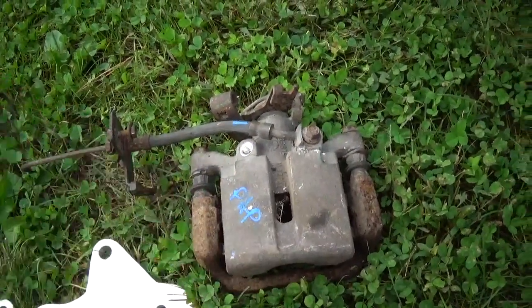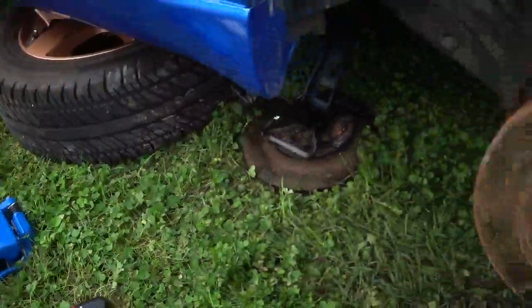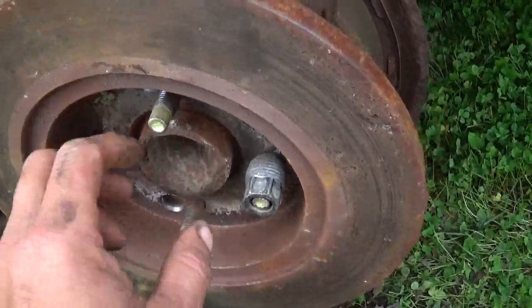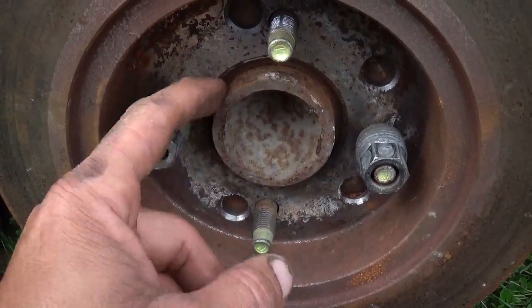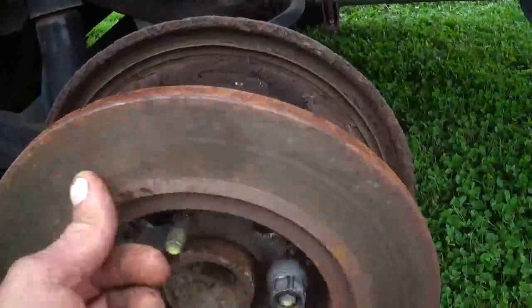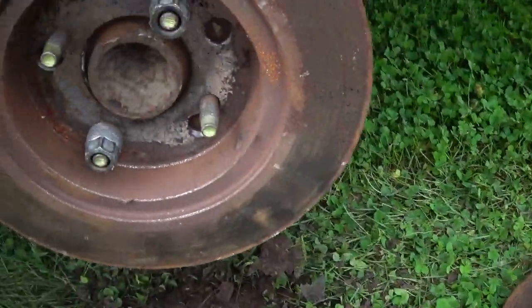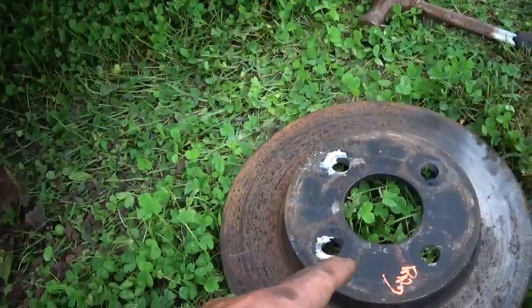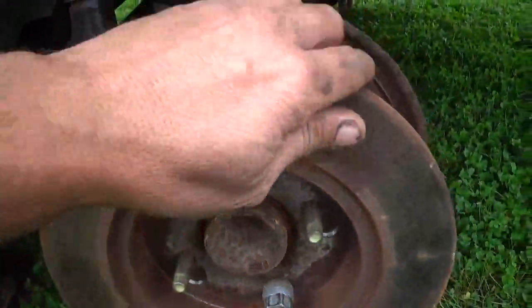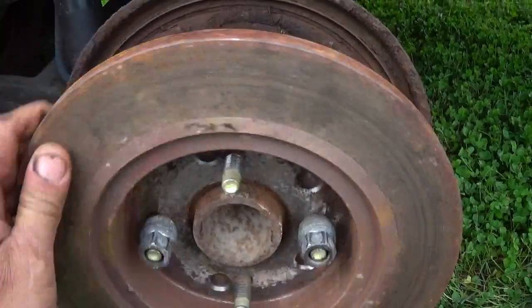Let's see if we can make this thing look a little bit better. We got that looking much better — looks sweet. Checking out my drilled holes and letting it run — you can see here the difference between this hub and the hole machined into that rotor. It runs pretty true, maybe out about five thousandths. The front rotor that actually does fit the axle hub runs out about twenty thousandths, so if that's good enough on the front, this is going to be good enough on the back. I think some wobble is from rust I haven't cleaned off.